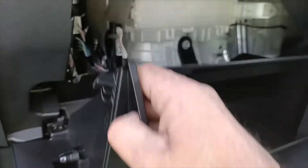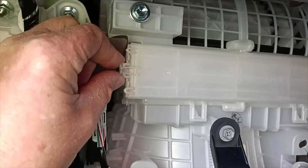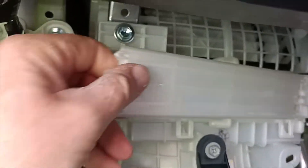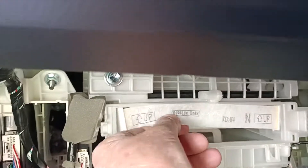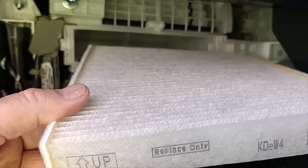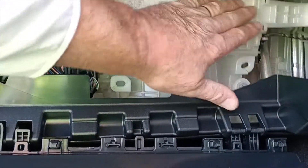To change it, we drop the glove box down by pulling in both sides and dropping that out of the way. Then there are two little clips — you pull them in and unclip that, take that out, and as you can see there's the filter. We can just pull that out, check it, and replace it.